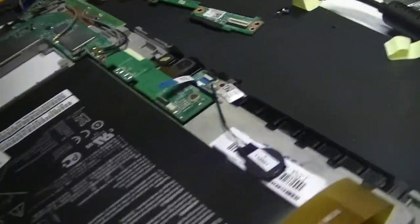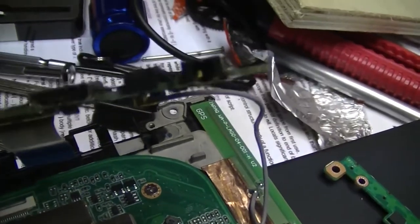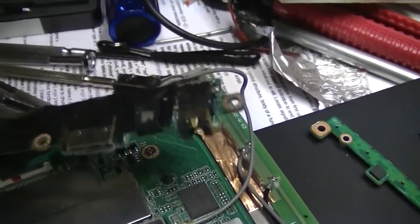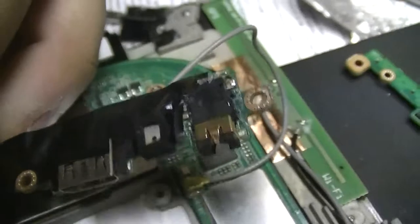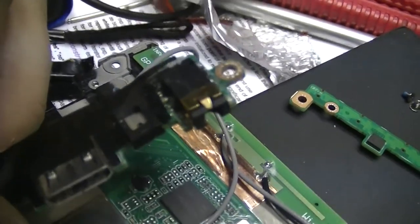I've already got a crack in my screen. All these little ribbon cables — some of them you can connect when the board is unscrewed, and some you have to wait until it's screwed. See that? It's a surface mount socket for a 3.5mm jack, and surface mount can't take a lot of tension or stress. You wiggle the jack cable or it gets bumped and the pads snap off. I had to go in and wire it down with little wire extensions so it wouldn't snap again — you'd need a microscope to see it.